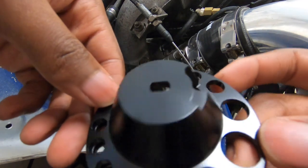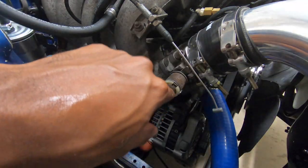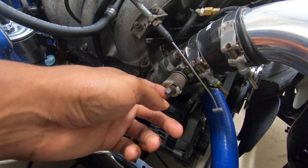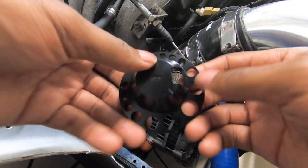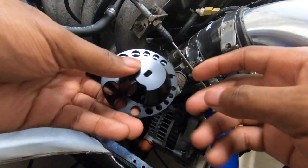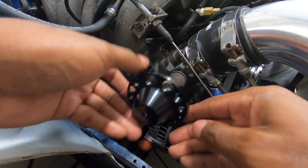When you're putting on the wheel, instead of a hole in the middle, it's like a slot. The actual bolt where the washer and the nut goes is slotted, so that tells you the correct orientation for the wheel to go on. If you look at it, you can see where the cable goes and figure out which way it should be going on.